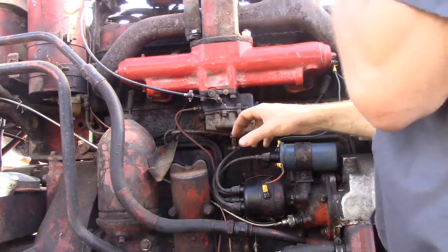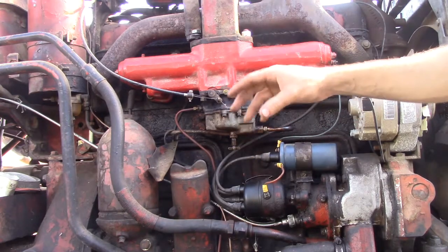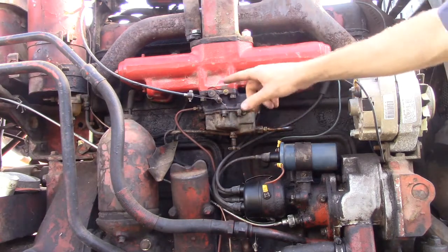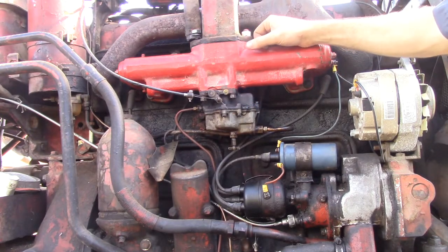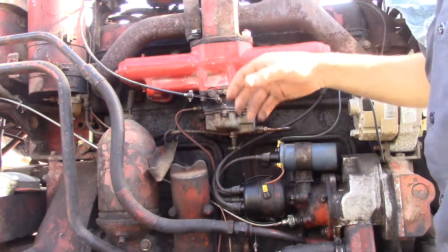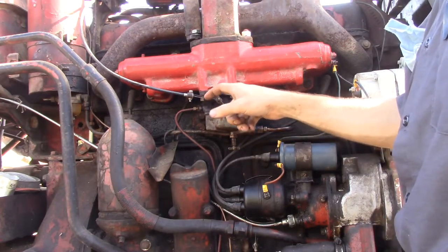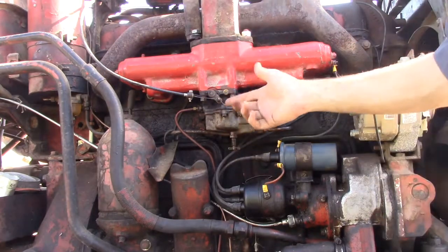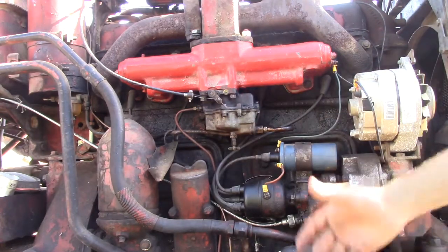The carburetor is a fixed throttle — there is no throttle per se on this. Your RPMs are controlled by how much air you let into the carburetor, which is adjusted by pulling the carburetor off. There's a butterfly in there; you can either adjust it up or down, and adjust your mixture to either lean or richen it to adjust your RPMs. On the 100 series the choke is on the outside with a cable. On the letter series there's a choke on the back side with a linkage, but you'll still have a lever indicator on the front that you can adjust manually if needed.